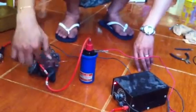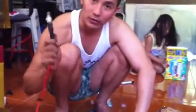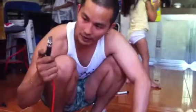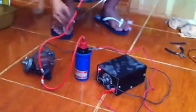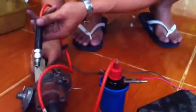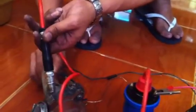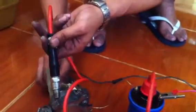Not at the same time, but it's going to be in a sequence. For this one, I'm only going to use one wire and one spark plug. I've got everything connected already, so I'm now ready to test if there's a spark at the end of the spark plug. I'm going to look for the number one — every time I turn the rotor, or this from the camshaft, and of course there's a rotor inside this — every time it turns, it should look for the wire that connects to the number one spark plug.